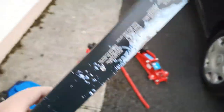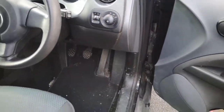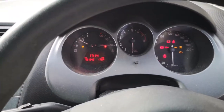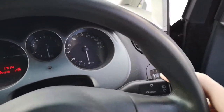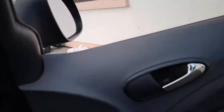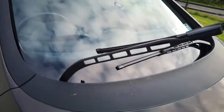Let's start off with the wiper blades — it's the least of my problems but something simple. On my car, the wiper blades are hidden behind a plastic cover, which is a quirk on some SEATs. To access them, you put the wipers into service mode: turn on the ignition, then turn it off, and press the lever down once as if wiping. Now they'll stay in that position.